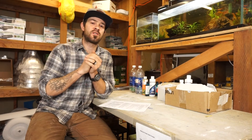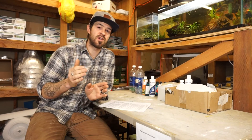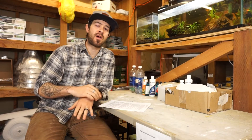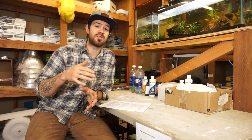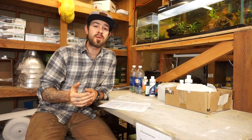Number seven — arguably one of the most important things, because it really determines the difference between a quality sterilizer and an economy sterilizer — is the lamp used. We are looking for hot cathode, low pressure lamps. Not the same as sold in discount stores, and not the same as a nail curing lamp, which is a medium pressure lamp. Medium pressure lamps have about 7% UVC output, where low pressure lamps have about 35% UVC output when looking at the spectrum. This makes a huge difference. It's common for discount UVs to use medium pressure lamps because they're cheaper, and many replacement lamps sold online are also medium pressure.